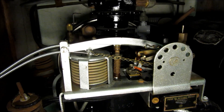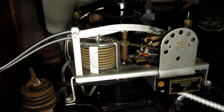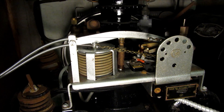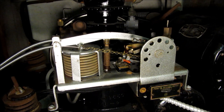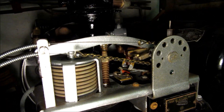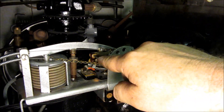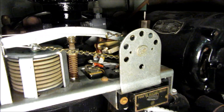The system is hot, so there's a lot of pressure on the low-pressure side — that's going to put a lot of stress on the compressor, so the belt may slip a little at first. Once it pulls down the temperature it'll calm down. I'm going to turn this knob, which will pull these cables and turn that little sprocket, and that lever will move out of the way and let the contacts close.